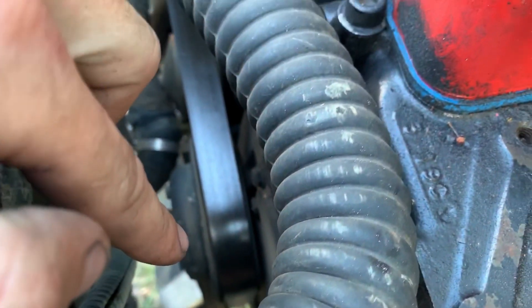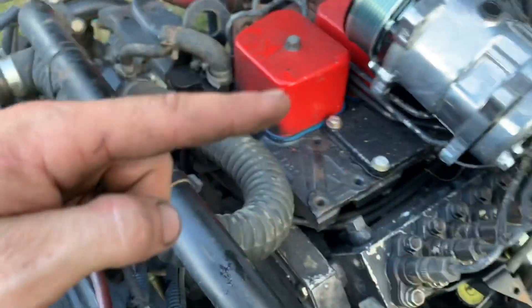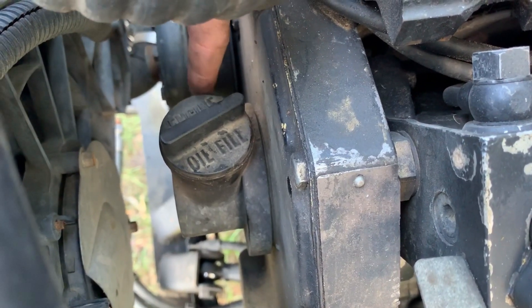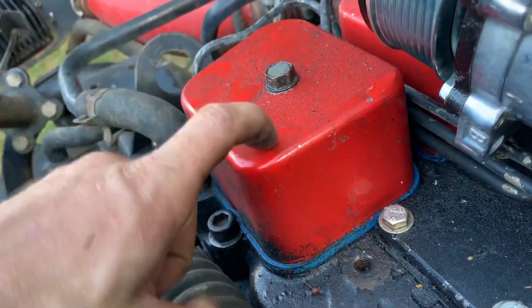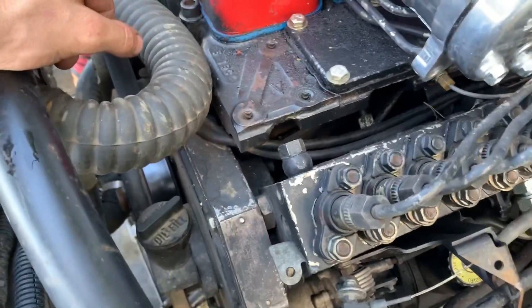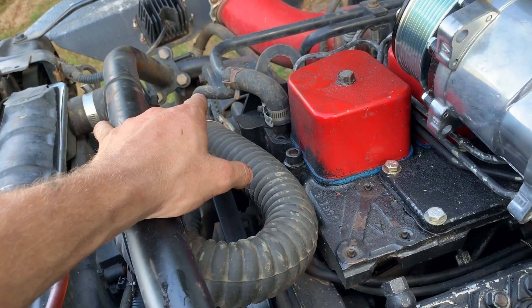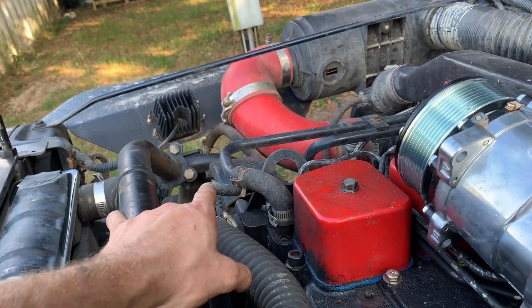If I went this route I'd have to move the radiator hose. I'd probably get rid of the fan pulley and make some sort of small idler pulley there, so the belt comes from the alternator, wraps underneath the pulley, comes up to the AC compressor, and then back down to the crank. I believe it'll be a super close fit right here — it might even just barely hit. I'd probably have to find a way to get rid of this breather and get a valve cover with an oil fill. This side just seems to involve a lot more extra steps.